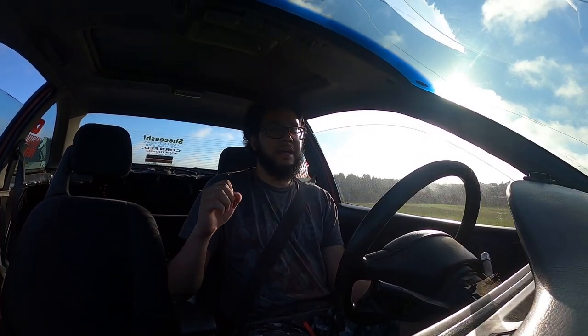This car, sometimes it runs like it'll cut off, and then it'll run with the check engine light on, like it's on two cylinders. And I thought I had pinpointed it. Well, I did kind of pinpoint what that problem was. It's actually in the ECU. When I first put the quick release hood on, I was gonna drive it, and it would not start back up. The fuel pump wouldn't prime, and I couldn't get the fuel pump to prime.